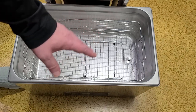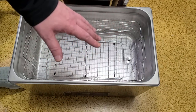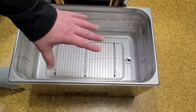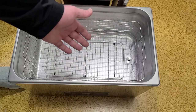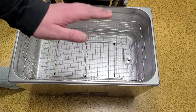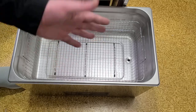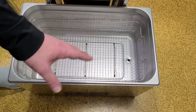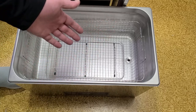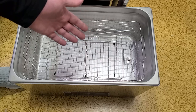Key takeaways: it is heated. They include an 18-gauge power cord, which is what they include on all of them, but on this largest 8-gallon, 30-liter unit it's too small. This has an 800-watt heater and 600 watts of ultrasonic power — too much for an 18-gauge power cord. That issue only really applies if you're getting this huge unit. The temperature controls work and it won't overheat — it has a sensor. I'll do a little teardown exploration inside at the end of the video.